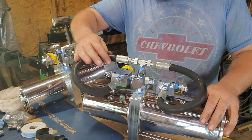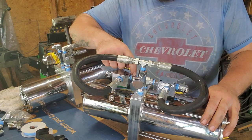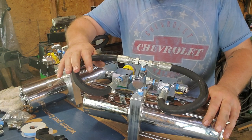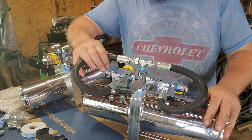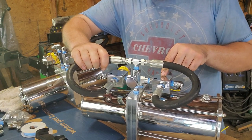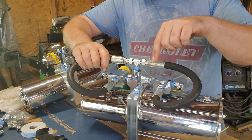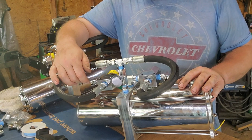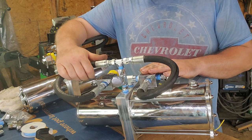People say a motor seal will cause your car to leak down — no it will not. Your check valve prevents that from happening. If you're getting oil out of your motor, you just have a bad motor seal. So if you look everywhere, everything's good, no external leaks, cylinders aren't leaking, hoses are good and tight — if the car lifts up, stays up, and just slowly leaks down — one of two things: first, close your slowdown valve. If you have a piece of trash stuck in that dump, fluid will bypass it and slowly creep back. Closing the valve manually shuts off that path.